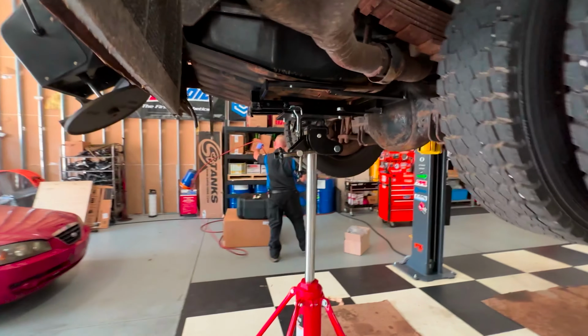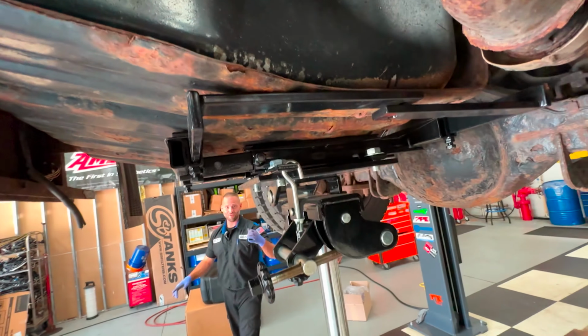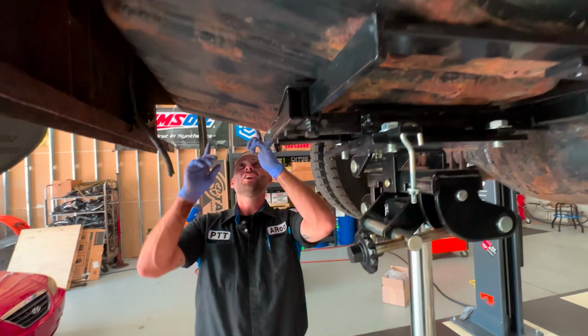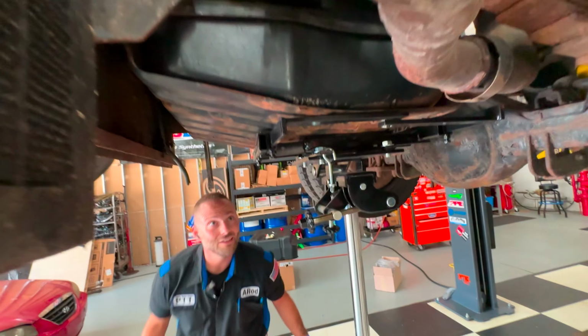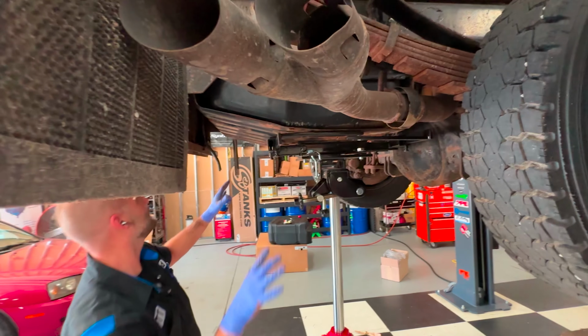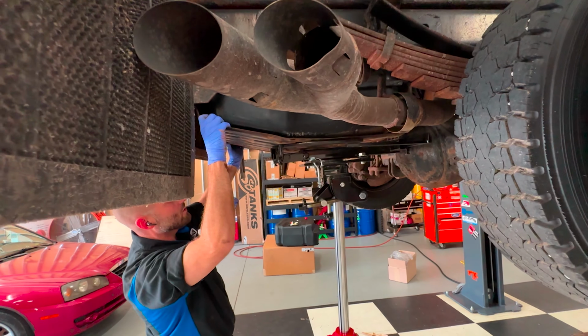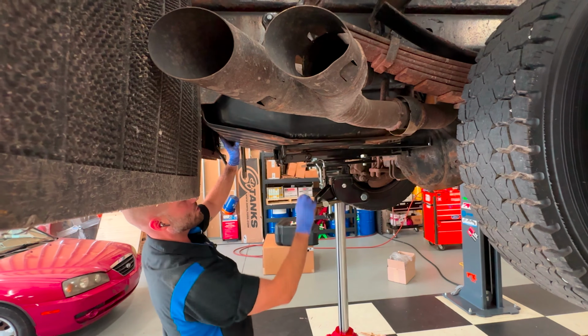Ugh. All right, so now that everything's disconnected, we have no bolts, we have no fuel lines, no fuel connector, and no filler pipe connections. This thing technically should come right down. Let's see. Okay, I feel like it wants to come towards me. So let me roll the tank towards the front of the vehicle. There we go. I feel like that's a little more secure. All right,